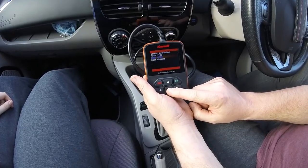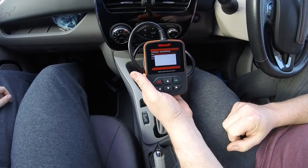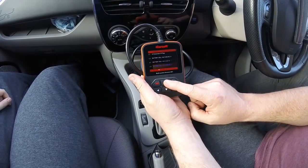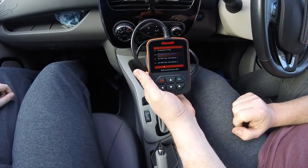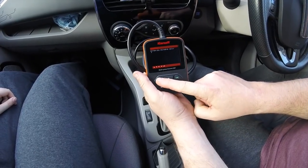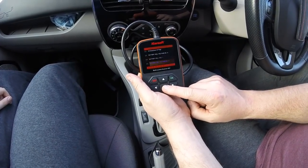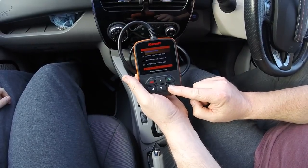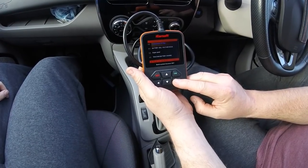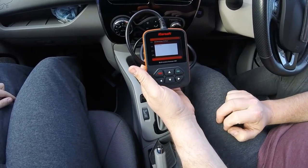Let's click OK and go to data streams. It starts loading all the battery information up. You've got all the different cell information, so if I click into one of these it will tell me what the voltage is. And it tells you what voltage it's at. You can go through these one at a time, next page, or you can quickly skip by just going across — that jumps basically each page. So if I go to battery traction charge this will tell us what the charge is.